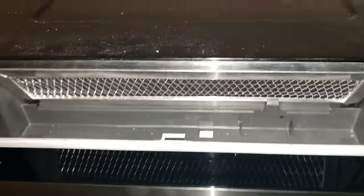I pull the microwave down. On top you can see we have the grill cover, and what we're going to do is remove this grill cover — there are going to be two screws. Go ahead and remove your grill cover and put it to the side.